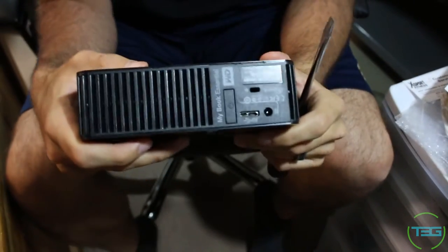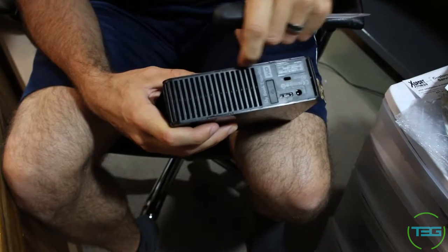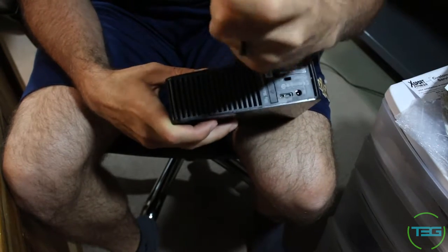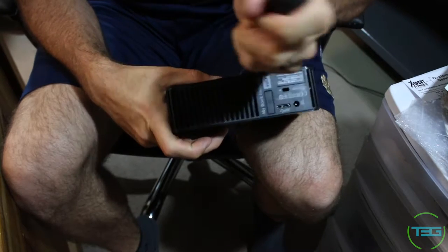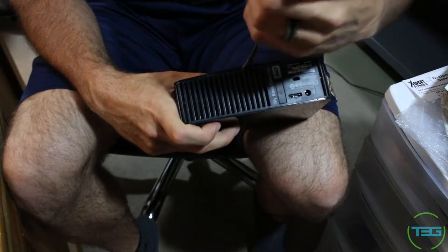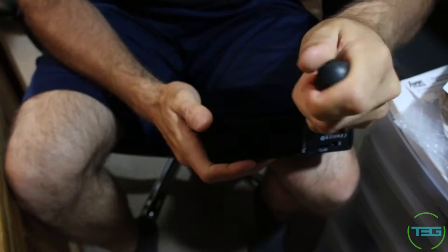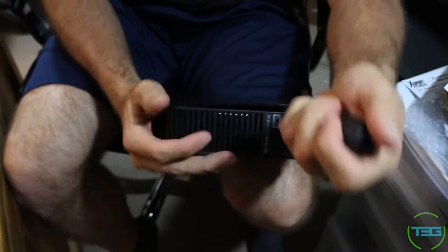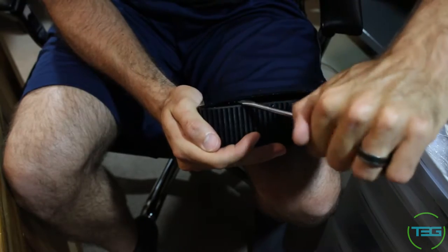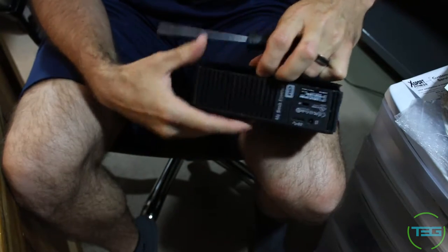You put your flat head in between this crack here and you try to get it in there little by little, moving around. You don't want to force it or slam it in there because you might damage the hard drive inside. Once it's in between, you just twist a little, move it over, twist again — you might need to pry it up. If you hear that pop, that means one of the clips has let loose. Go to the other side and do the same thing.